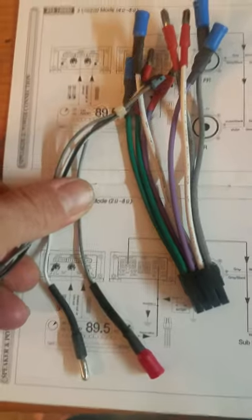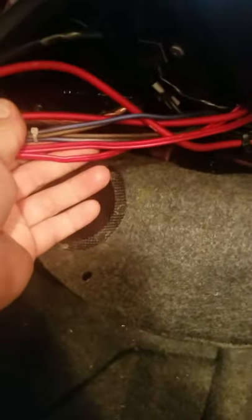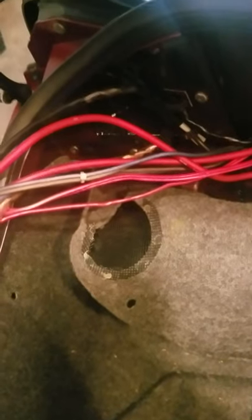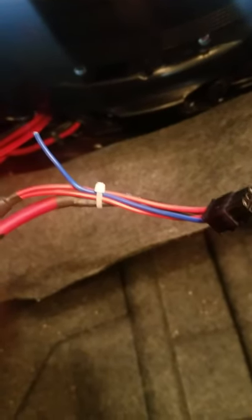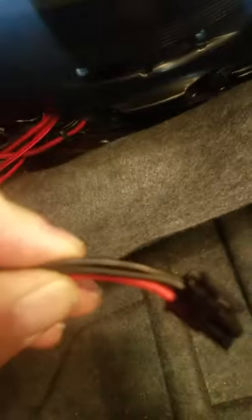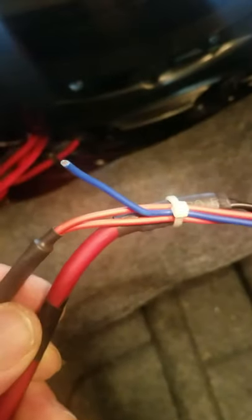The input speaker wire is tiny — if you look at them next to each other it's amazing how thin it is. I'm running pretty good stuff: I'm running 8-gauge power and 8-gauge ground. Off the bike I have some good speaker wire in different colors because I'm running front input and then back, out to front and rear. It's all color-coded so I know where it's coming from. This is going to be the power and remote. The guy on the phone said you need a remote to activate this; the manual says you do not, so I didn't attach it.